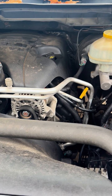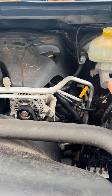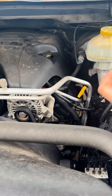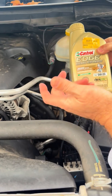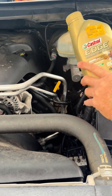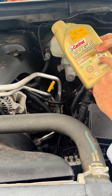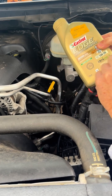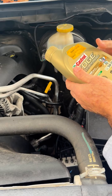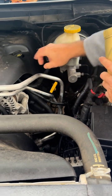There are different viscosities — like 0W-20, which is usually used for colder climates or to improve gas mileage. A 5W-20 is just a year-round oil. They've got 5W-30, and they've got like a 10W-40, which would definitely be for summer. What it means is it flows like a five and protects like a 20. If it's a 10, it flows a little slower but protects like a 40. So you want to think about what viscosity you use, but I would definitely use whatever is recommended by the manufacturer.